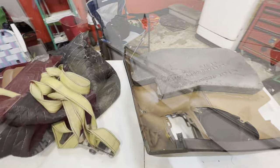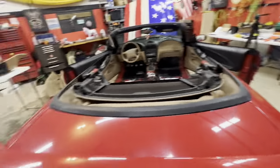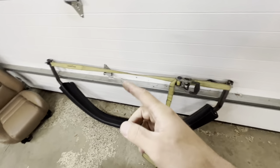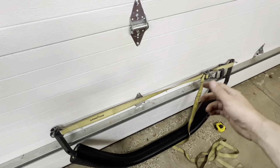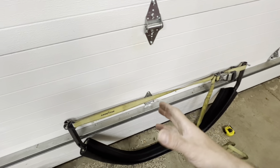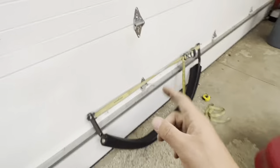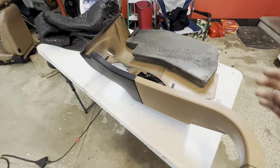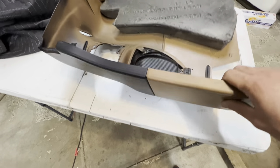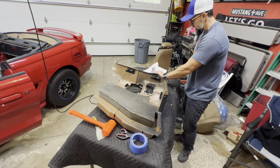Here's what I did for the bar to get the right overall length. I measured the car and it's about 55 and 3/4 inches from bolt hole to bolt hole. The bar right now is about 54 inches so I'll leave the ratchet strap on it. When I do the ratchet strap I'll set it maybe two inches shorter so it'll have some spring when it comes back out. I think that's a good trick I didn't see on any of the other YouTube videos.